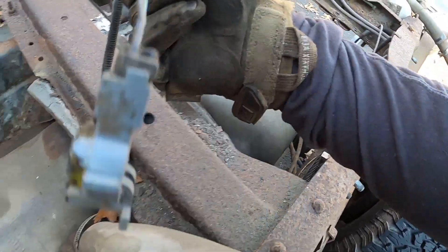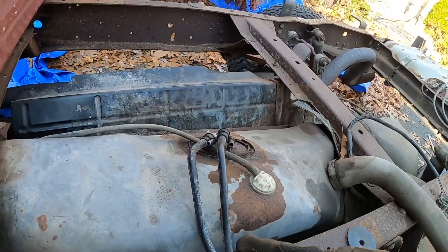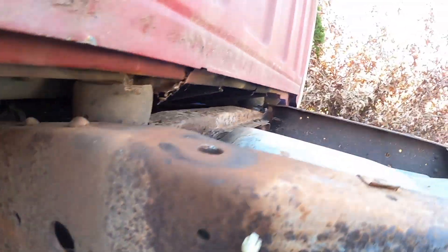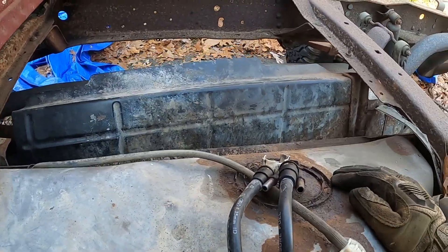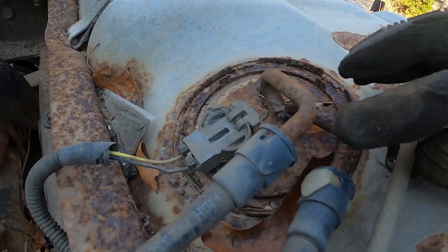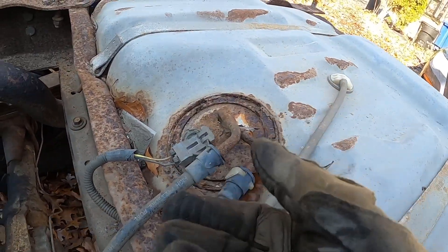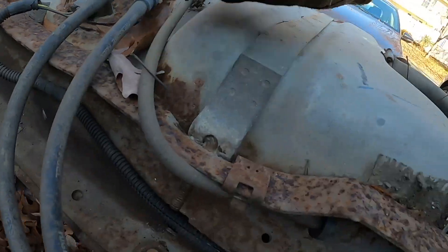I just disconnected the plug for the wiring harness, which is right here. I've already disconnected a lot of the screws on this one — there's one here, one right here, two right here, two right there — grinding them off. There's also one back there, and then this tank will be ready to drop. On this one, there's just a clip right here — you push these in or take a needle nose or a flathead and just pry it out. They'll just pop right off, super easy. Then this is just a clip — just unclip it and pull this out.